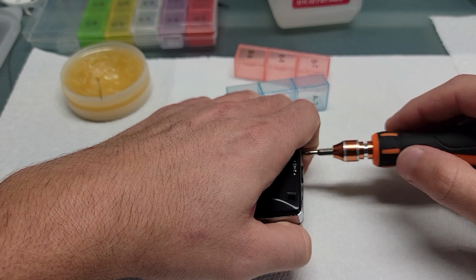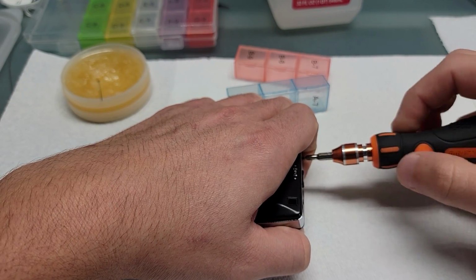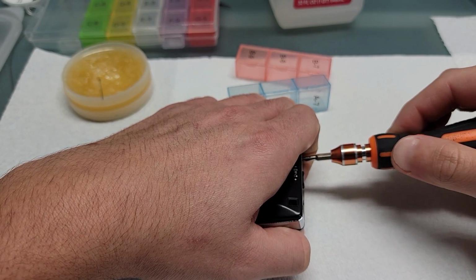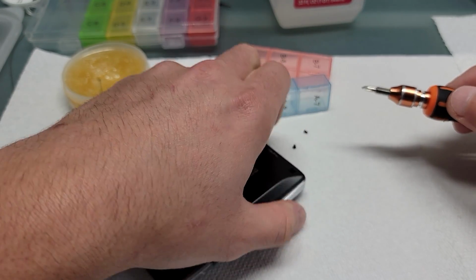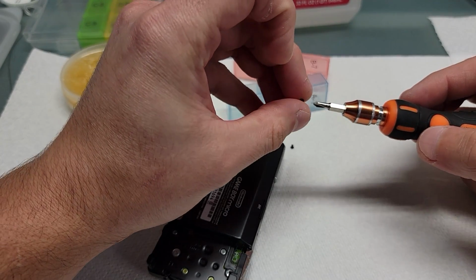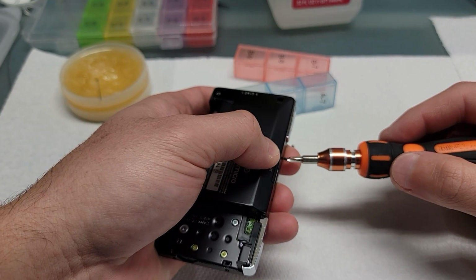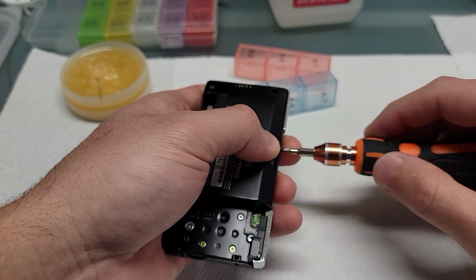A few back turns, and then you'll hear the click. You start to tighten, and then here you want to be really, really careful with your knocking. I use like 2 fingers to do the knocking because stripping these tiny little screws is very easy. It kind of doesn't make sense that they use tri-wing because with small screws, I guess you would want a few extra things to catch onto when you're screwing. So maybe a Phillips head would have been better.